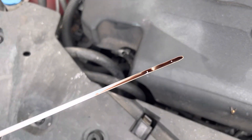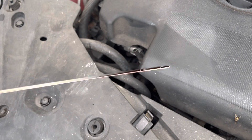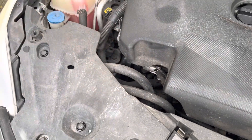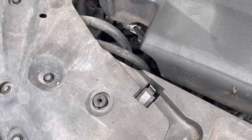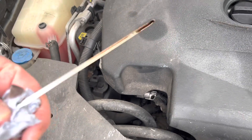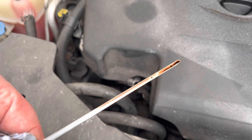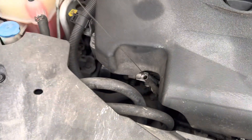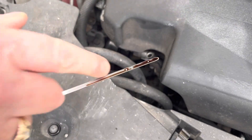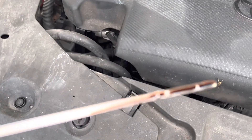There — you see it looks as if it's way over full, as you can see here. It done it here a little bit too, but you can see roughly where the oil is and work it out. But with this here you'd be thinking that you had too much oil in your engine and panic bells alert — but not to be. The reason for that is, when it rubs against this pipe here, it just builds up on it. So the reading you need to take is this one here — that's the true reading. That other side is scary looking but it's not the right one. That's the true reading — it's just on the full. In and out again, that's the right one, and you can see there's some rubbing against the inside of the pipe.